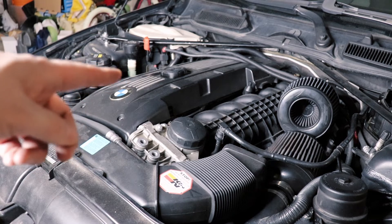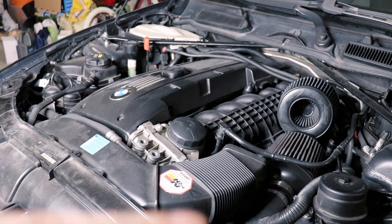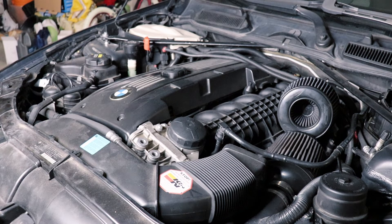That shows you what to expect if your O2 sensor fails on pretty much any car — that's probably how it will fail. It will read lean and give too much fuel, more fuel than needed. I'm going to put a link in the description for where you can buy an oxygen sensor for this car — primary and secondary O2 sensors, Bank 1 and Bank 2. You're probably going to want to do them together; I really should have way back then. If you've got more than 150,000 miles, change out your Bank 1 and Bank 2 O2 sensors — it may help with fuel economy anyway. That one had 190,000 miles on it probably, so you can't really complain. Thanks for watching, consider subscribing for more content like this — I upload regularly.